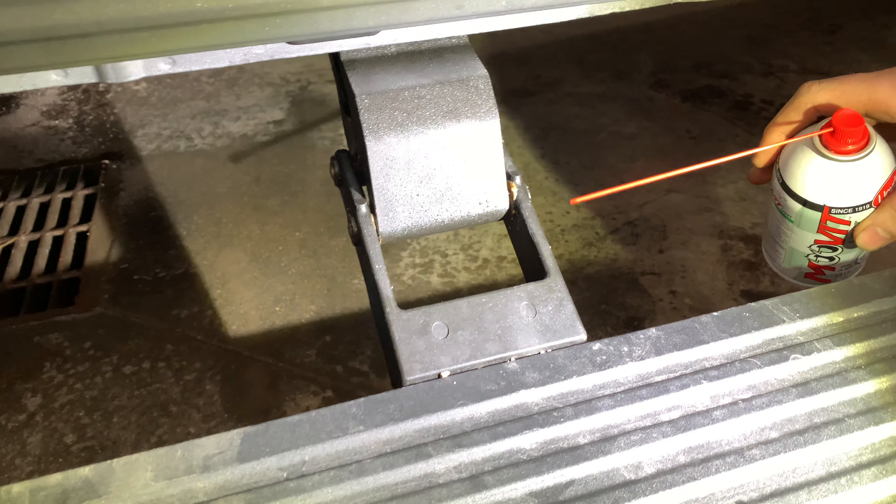There's what I believe is a brass mesh sleeve in there. As you can see, rust — that's the culprit, that's what does them in. So clean them up and keep them lubed right from brand new. Or if you just bought a truck, I would be checking those out right away. Make sure you get those lubed up so they last a while.